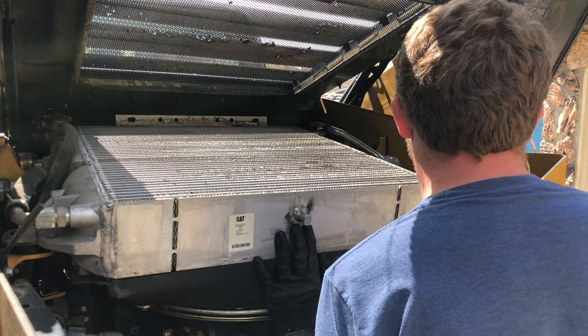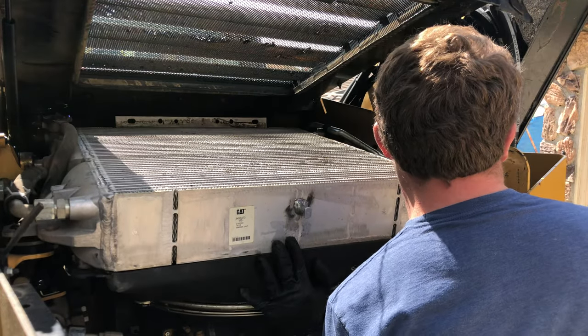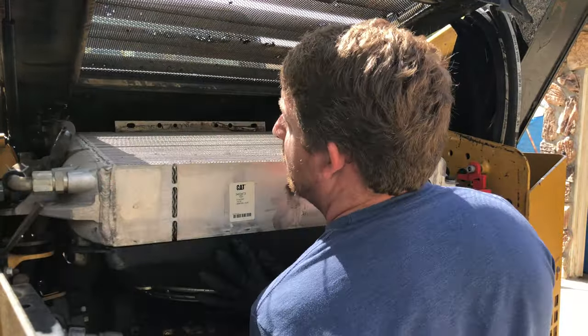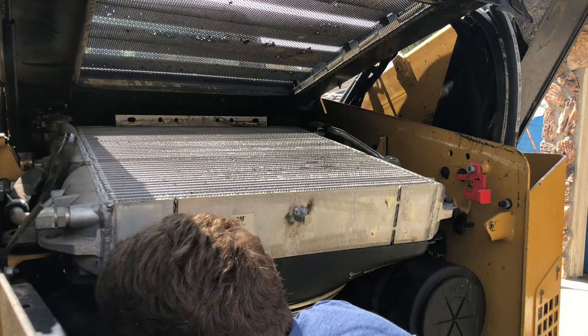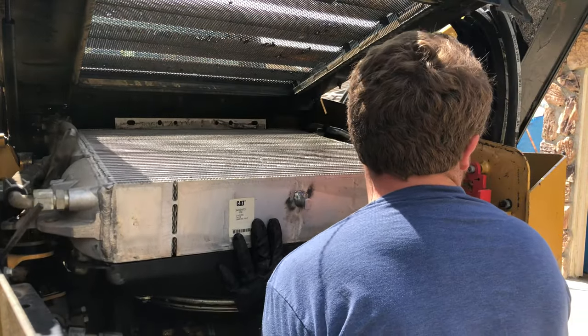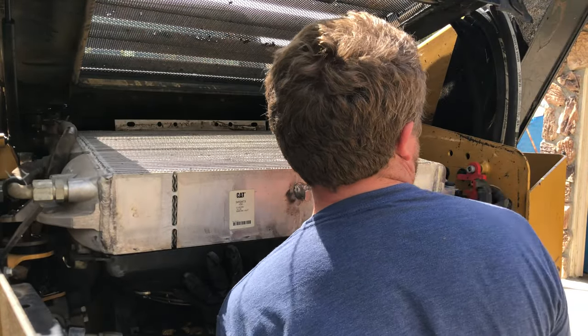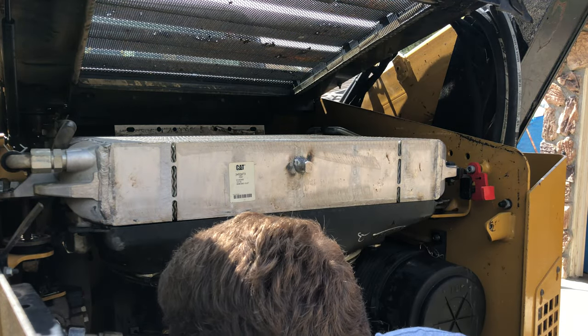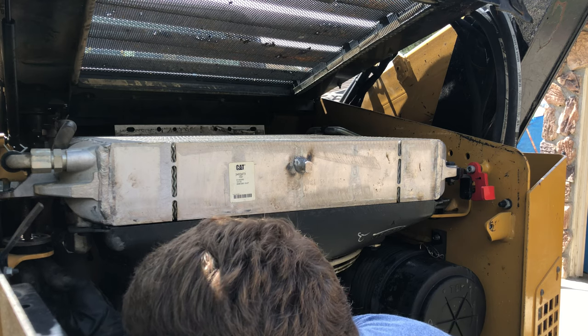See if it rotates. It wants to, and it's heavy. After I broke it loose, it still didn't want to quite rotate. I found that a coolant hose that went to the top was zip-tied in a way that wouldn't allow it to freely rotate up. So I cut that off, lifted it up, and locked it in place. That was a lot of work for just a few more inches, but I guess that's what you need to be able to get at this motor and radiator.